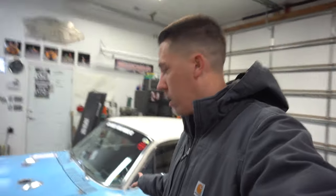I just need to sit here and play with the dyno and try to get repeatable runs for myself, for the car, and figure out what settings I need to use, maybe in HP Tuners, to lock the car into fourth. It would work, then it wouldn't, and that's some of the pain with stock computer, electronic transmission stuff anyway. So not exactly the easiest car. If we had something like the Buick on there, yes it makes a bunch more power, but when you put it in a gear, it's gonna stay in the gear until you shift it.